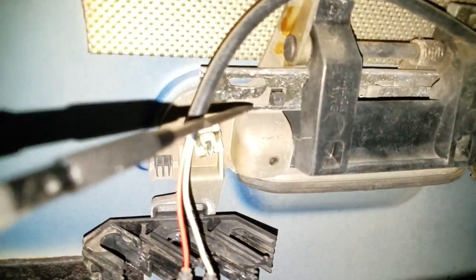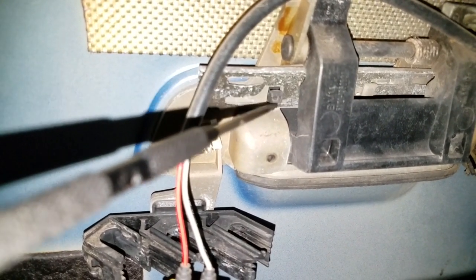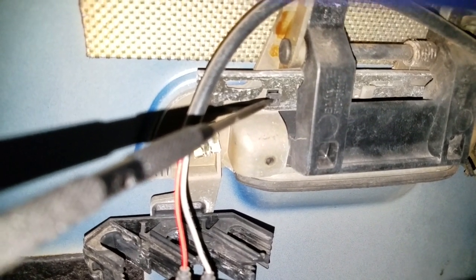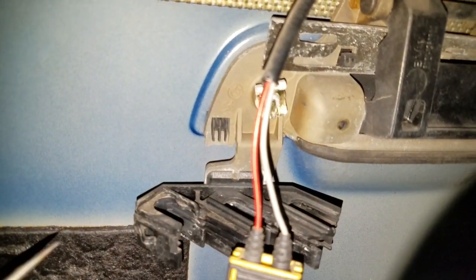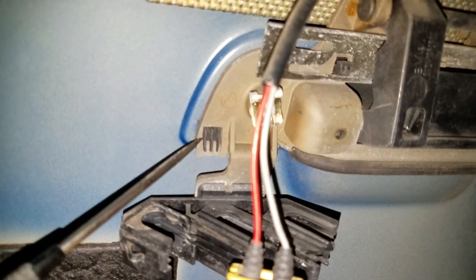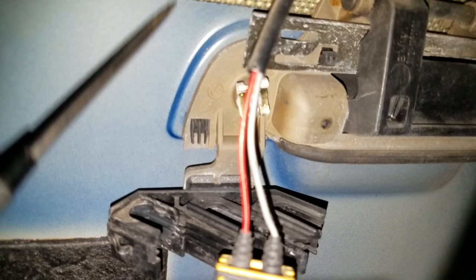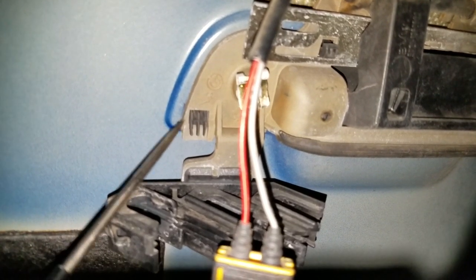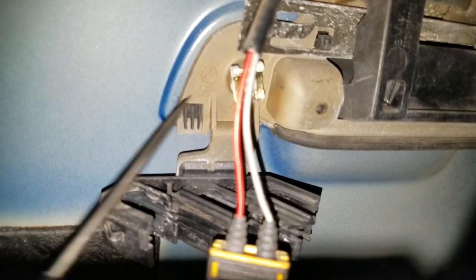I was able to push this metal plate far enough. See — now this tab you can pull it from the outside. Before we do that, just note this plastic tab that's also holding the handle plate on the top. As you're pulling, make sure you pull up, because if you pull straight back you might break this.